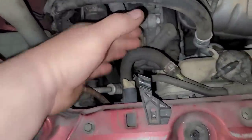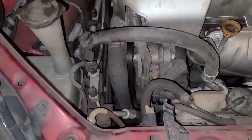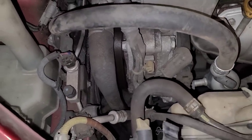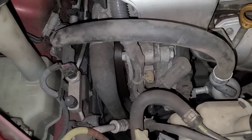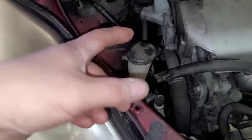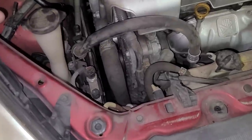So I just looked it up. To get this alternator out, what they want you to do — and I'm not kidding — they want you to pull the entire bumper cover off, pull the headlight out, pull the radiator support out, pull the radiator out, pull all the hoses off, and then this thing's supposed to come out through there. I don't think so. I'm going to try to do this as minimalistic as possible. I've got to pull the right front wheel off and pull the shield out from underneath. But pulling all of that out — pulling the headlight out — that's just insanity.